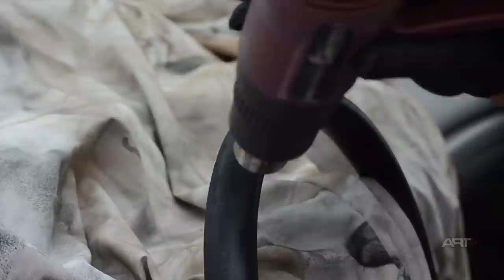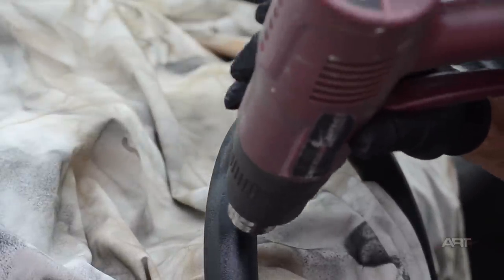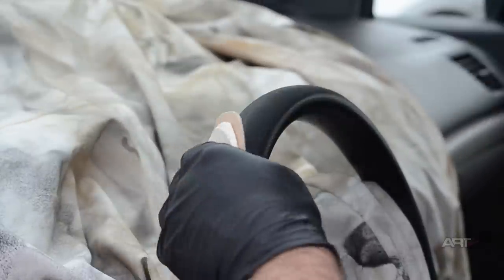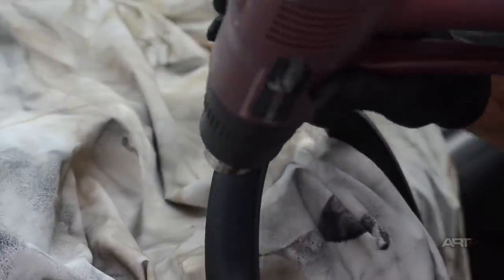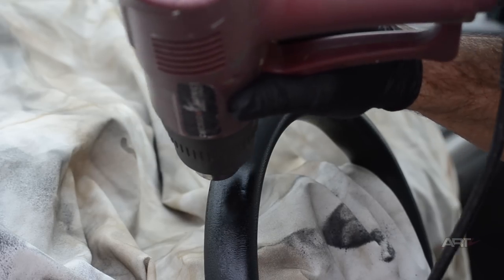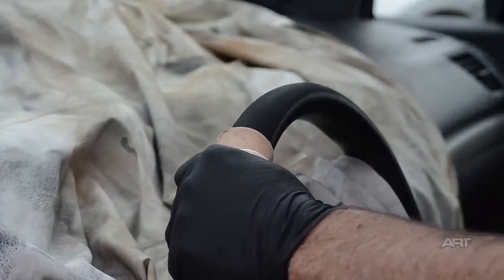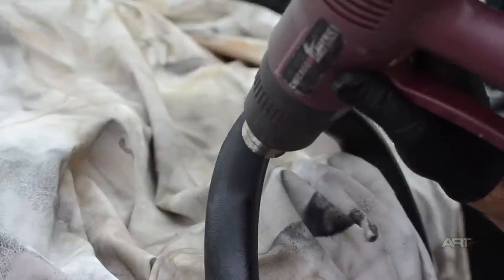So quite typically, you're going to heat it until the foam gets melted, it gets shiny, and even blistered up is okay. The thing is, the more liquefied the foam, the better the grain impression. As you notice, I'm using two layers of graining pad. One is thin, that's the one with the correct grain. And then there's a thicker backup so that I don't leave finger impressions. Also, the thicker pad protects your fingers from the intense heat there.